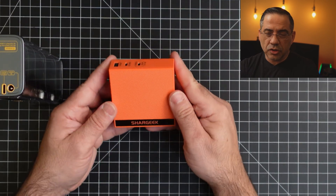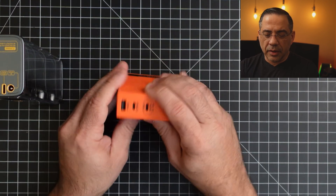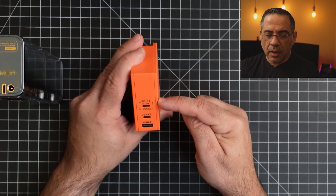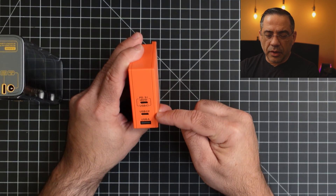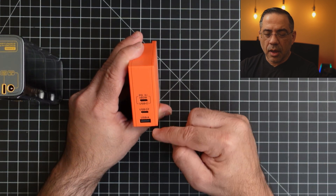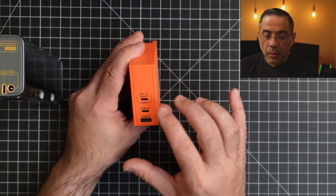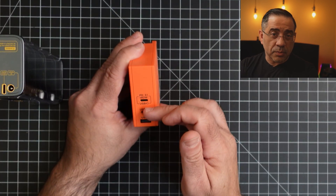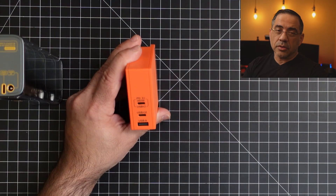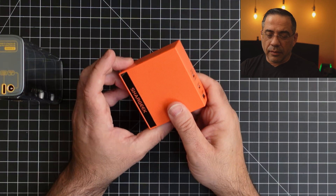In addition, we have their GAN charger, which is also pretty neat. I like the folding legs and how large all the fonts are — it tells you this is your PD port at 140 watts. Over here you have C2 charging, so you have C1 and C2, your two USB-C chargers. I misspoke earlier calling it 100 watts — it's actually 140 watts. It distributes power across all ports to give you the best charging rate. If you plug in two Samsung phones, one charges super fast and the other drops down, which protects both the charger and your phone.